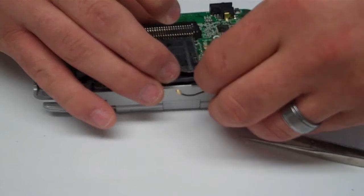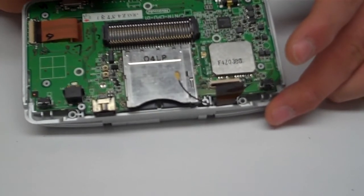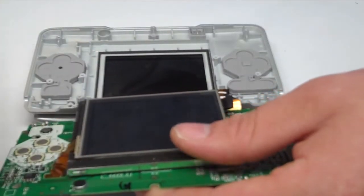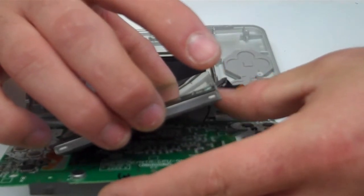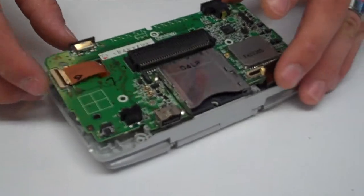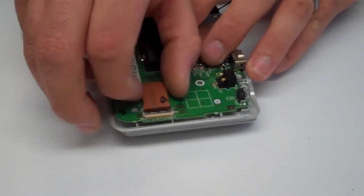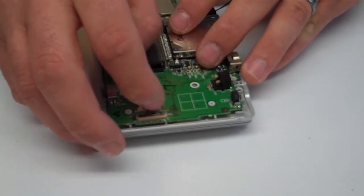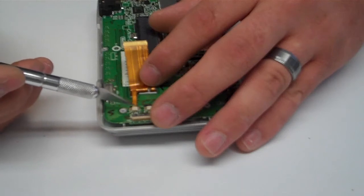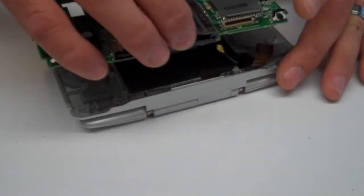Once you have that removed, lift up the lower half of the unit and push in from the touch screen to lay the motherboard over. On the back of your LCD are the ribbon cables. Go ahead and disassemble the motherboard from the LCD — you have a ribbon cable clip here. Pull that and gently wiggle it out. The touch screen clip may come out with it; there's a little slider there. Slide out the other side, pull the cable loose, and lift the motherboard completely off and set it to the side.